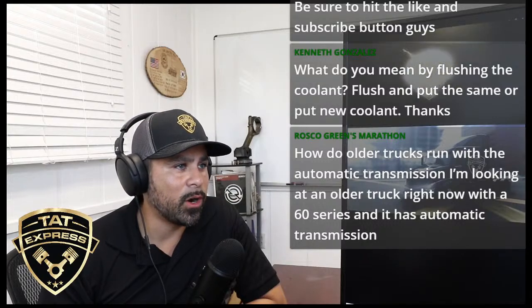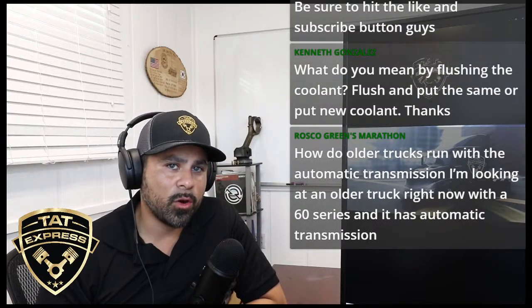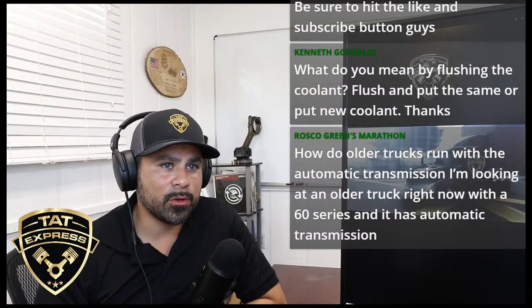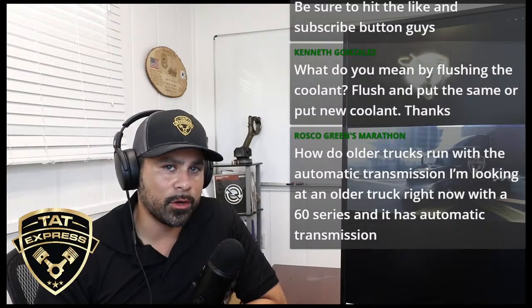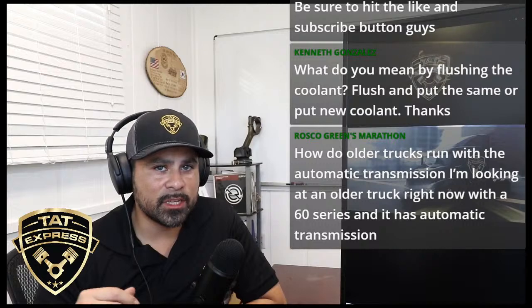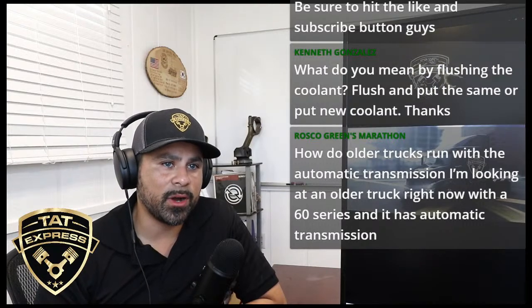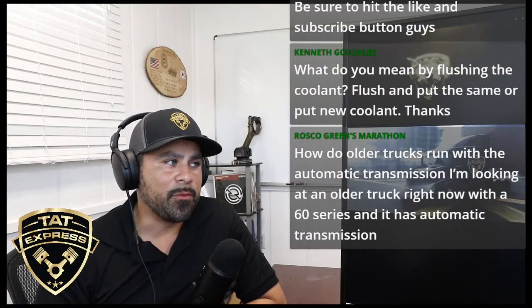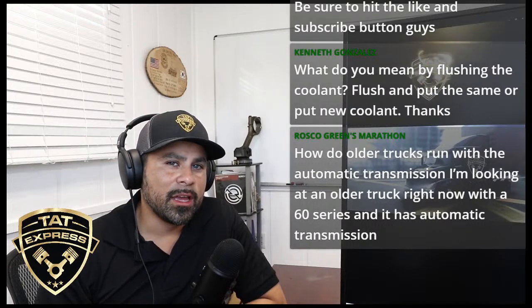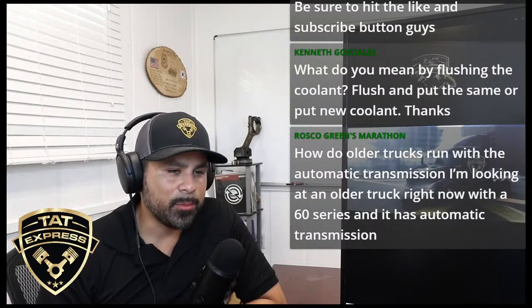So when they cut fleet washing, you're having to worry about corrosion. You're having to worry about new, inexperienced drivers driving those trucks, learning on that truck. Corrosion, lack of maintenance, those are the types of things you all got to keep in mind when you're buying a used truck. If you go to a sales yard or a dealership and they only got one or two left out of 60 or whatnot, be careful. Those are going to be the ones that may be giving you the biggest headache.